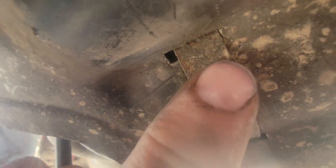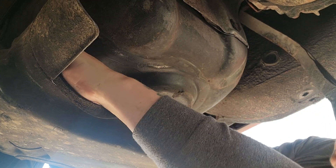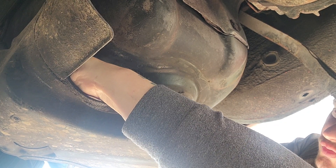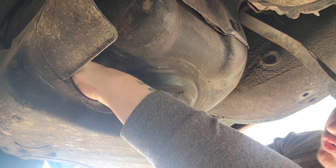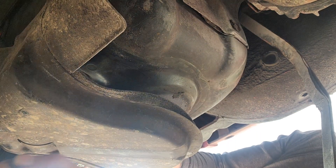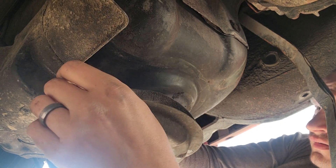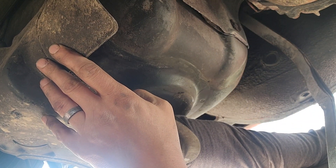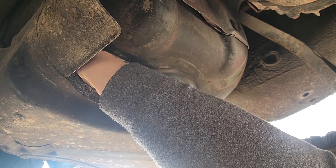The entire fuel system is attached — the skid plate is kind of just floating up here. We wiggle it to see if it comes out. Worth mentioning this is still just a guess; we don't even know if the fuel pump is the actual problem yet. There are clamps here for the fuel pump plugs. The plug piece on the fuel pump just fell apart and disintegrated — so there's a problem right there. Someone has been in here before — there are butt splice connectors on the wires for the plugs, so someone has already replaced something, maybe the wire or the fuel pump.